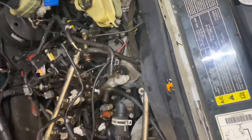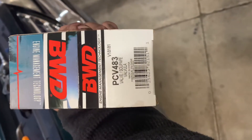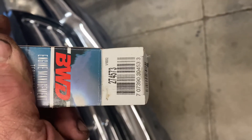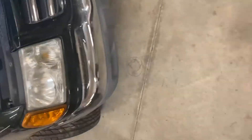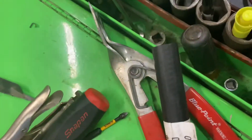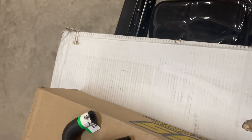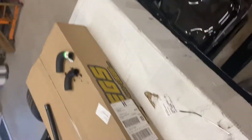For the 2002 Ford Ranger, the PCV valve — they do have it at Advance Auto Parts — is VWD 483. The o-rings kit is VWD 274573. The hose I got — I cut the sticker but it's 80400 — I cut about three inches off one side and about an inch and a half off the other. That's going to be my new elbow to replace the really soft, oily, yucky original one. Anyway, that's all I got folks, hope it helps.